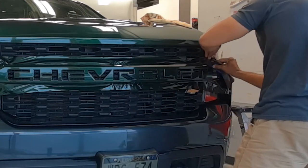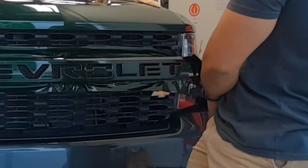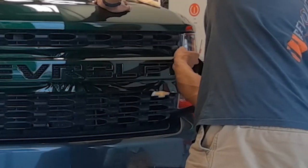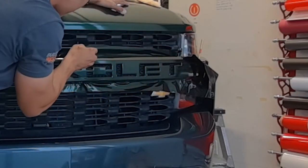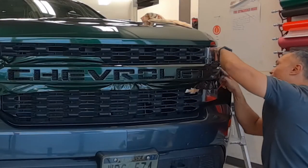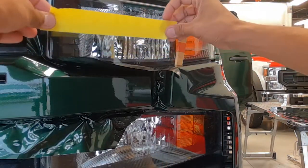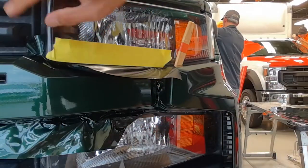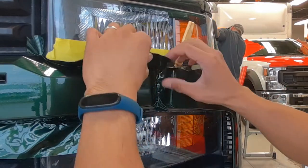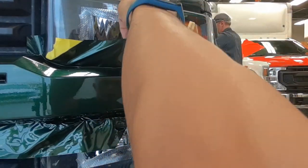I already laid down the top flats and now I'm working on the bottom flats. I'm reaching the first kind of dip where the bar meets the headlight and angles a little bit, then finishing off the top. I'm cutting off the part where it starts at the headlight and going to about the middle. There's a plastic trim piece where the painted portion meets it and I'm floating my blade in between there. I also forgot to put some tape on the headlight — the reason being it creates a lower surface energy so that flap of vinyl won't stick quite so hard to it.